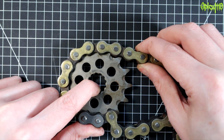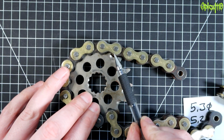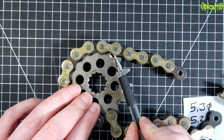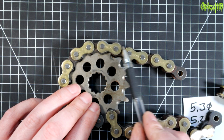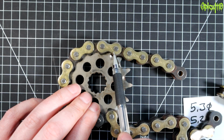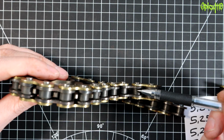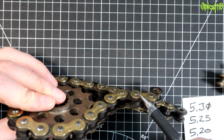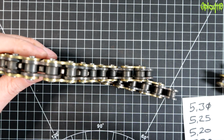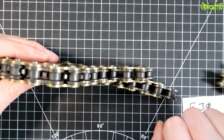It's going to get around here to a certain point where it won't want to turn, and then it's just going to snap. Now, when it snaps on one side, that automatically puts a huge amount of pressure onto the top surface, which is going to cause this piece here to go flying off, most likely. That then causes all of the load to go on the opposite side of the chain, and it wrenches the side off over the peening, very often, it would seem, or even just pulls the whole thing apart, and it just breaks in two.